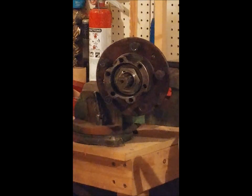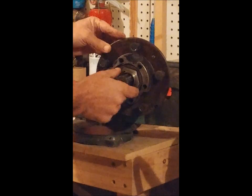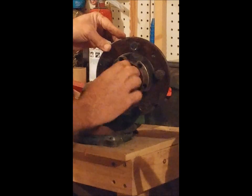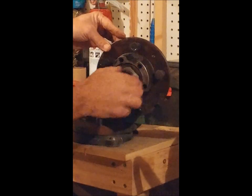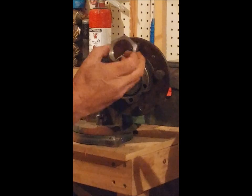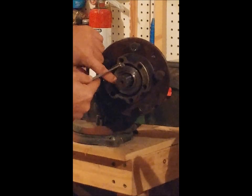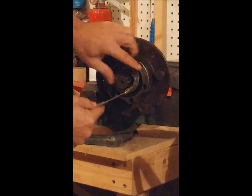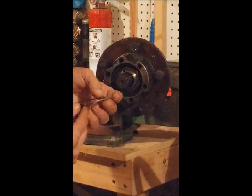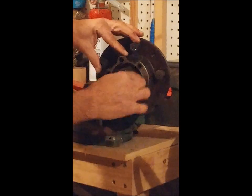The hub itself, if it's your application as well, has two of these two-and-a-quarter-inch six-sided nuts. The first one's the same as the second one, but they do have a space in between for a washer. The first washer itself does have a detent, which you can see right here, which separates it from the second washer. Then you have a second nut.